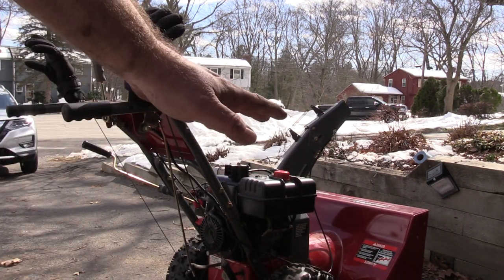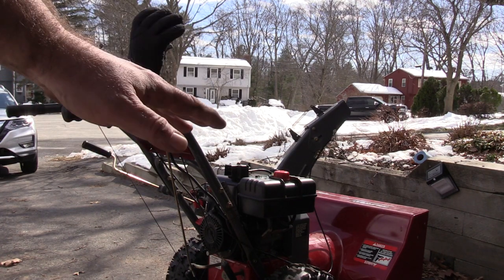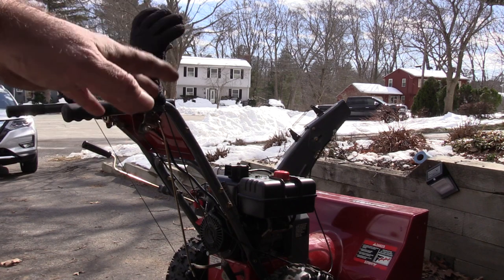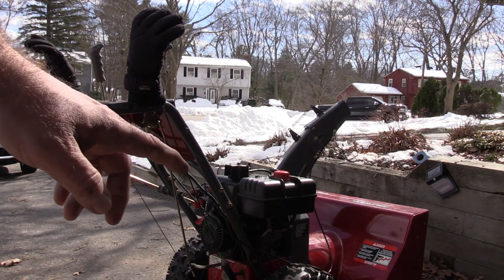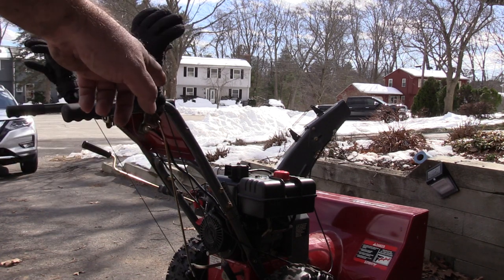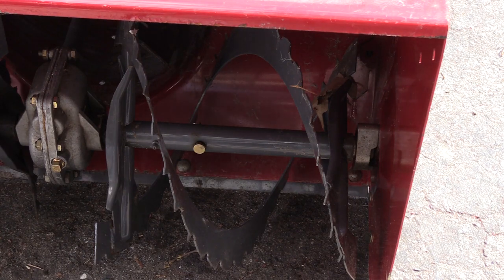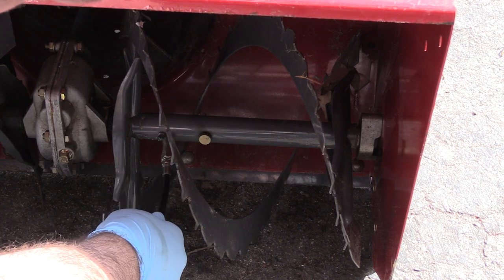The way you set the depth of the foot is: put the snowblower on a flat level surface, put a piece of cardboard or an eighth-inch spacer under the front blade, let the foot fall, and tighten it up — that's supposedly the right gap. I'll do a video on that when I get the new feet in. Now we're going to let this sit, give plenty of time for the oil to get back down to the base of the engine. Before I put the spark plug wire back on, I'll pull the start cord a few times to prime the motor.